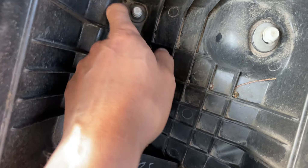This is the only part I was concerned about — how to secure this piece without a bolt, which I don't have an extra bolt right now. Even if I do a pop clip or something, it's going to be a little loose. Someone on the Facebook group, EcoDiesels on Jeep Grand Cherokees, said they got it to fit except theirs was rubbing over here — I could see where it's super close. However, I just kind of re-oriented some of the pipes and got it to work. This is my temporary solution; once I actually put a bolt down here I think it won't rub at all. So I want to start it up and see how it goes.